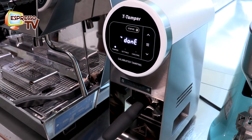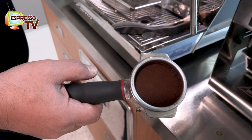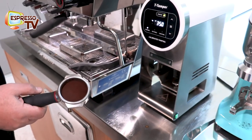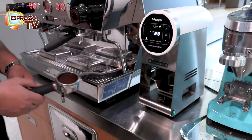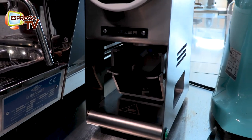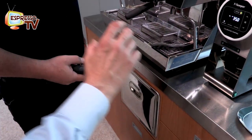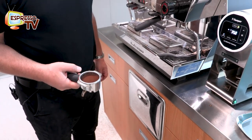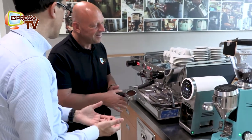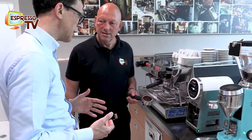Now we come to something new - this auto-tamper. It's a method developed and presented in Milan. In July we are going to start production. It's an auto-tamper where the tamping force is controlled by a load cell, so the grinder has a scale behind the chassis. The tamper has the load cell - it tamps and levels at the same time, distributing the grinds as the disc rotates when touching the coffee. What is the difference from a standard puck press? First of all, we control the force - we control how much tamping force by using the load cell, so we know exactly how consistent it is.